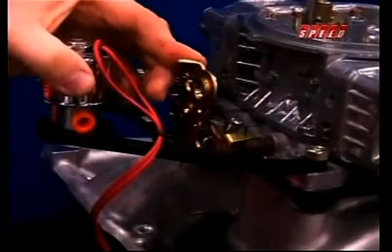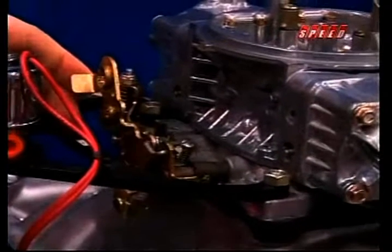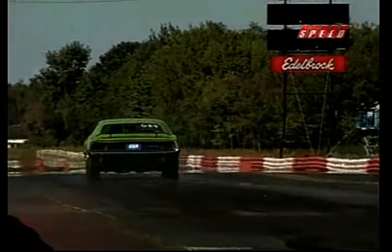How do you get it so that you can put a little bit of fuel in to make it idle, and have the right air-fuel ratio at idle? You restrict the air with a throttle. So all a throttle does is regulate the air density in the intake manifold. That's all it does. But when your foot's already on the floor and you want more, what are you going to do? What's life after wide open throttle?